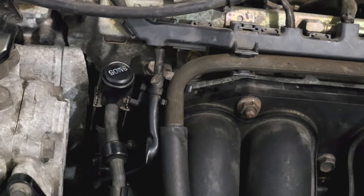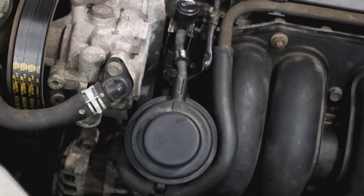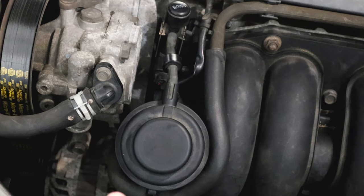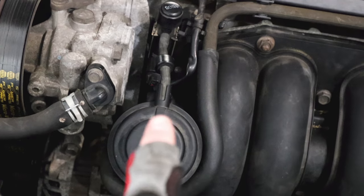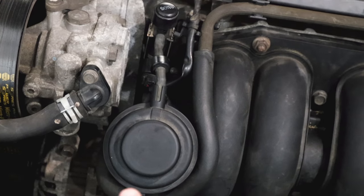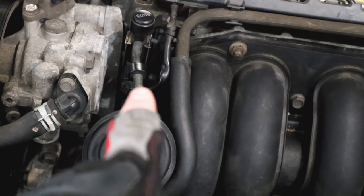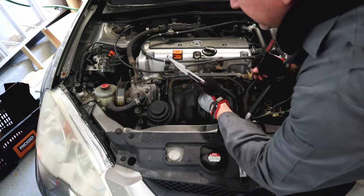Here's the solenoid. You can see it has a vacuum hose connected to the control valve. There's a bladder in it - vacuum is pulled on it, the actual intake runner turns, and the position of the intake runners is fed back through the system via the intake runner position sensor mounted on the side of the intake runner. We're going to make sure all our electrical and hoses are plugged in. Then we'll check the control valve to see if we've got any vacuum being pulled. I'm going to pull this vacuum hose and start the car up - go to about 3000 RPMs. When the radiator fan comes on we should see some vacuum being pulled.